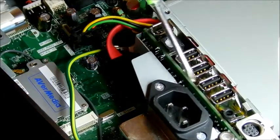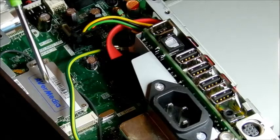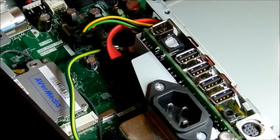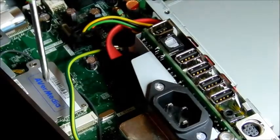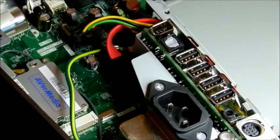Here's your AC power — that's all your USB ports and so on. Right here is your TV card. This has two screws and one piece just like the WAN card. You pop this cable straight up, take the two screws out, and back it out that way to replace it. I've never seen one of these fail, so there's really no reason to remove it unless you're salvaging the computer.